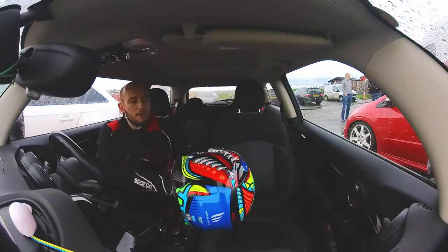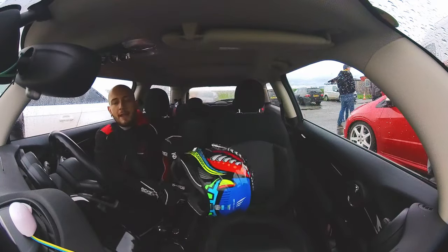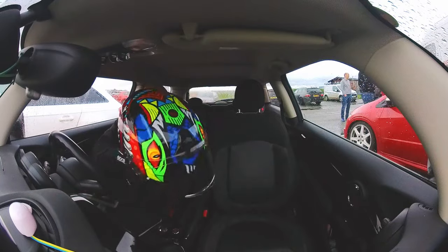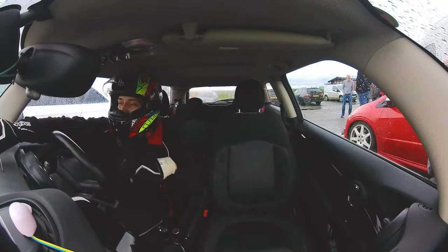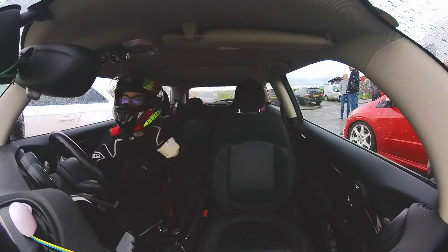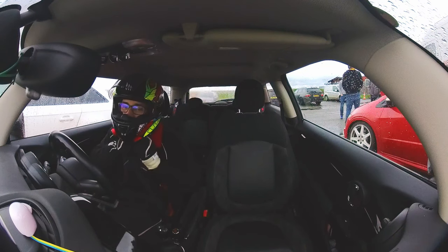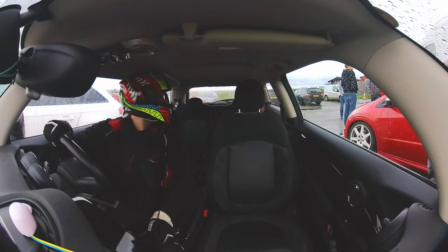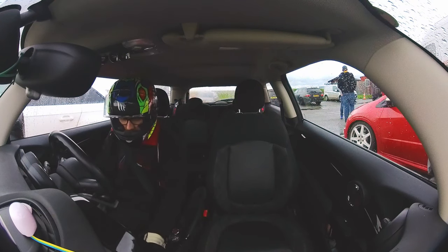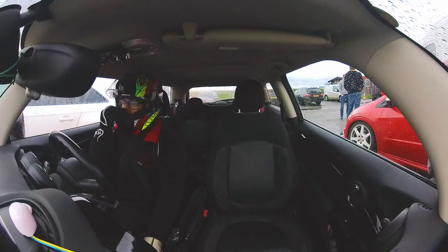Right then, we're off back out after setting the tyre pressures on the front. Should be a bit better now. We're at 40 psi, which is just too much. Talked to the camber and combustion guys and they both seemed on board with the idea of 35, because I have no idea about setting tyre pressures. I just neglected to at Snap the other week and had the same problem, the front washing out all the time. So, can turn traction off and see how this goes.